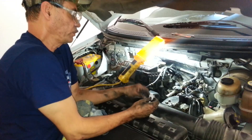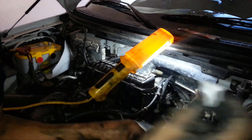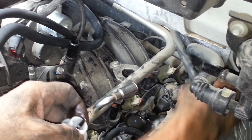You want to make sure you put on your safety goggles. You're going to be using this special tool — the size you need is 5/8 — and you first remove this lock from here. Then you put this in here and all you do is push back on it. You can feel right there where it released it, and just pull it back. This one didn't have any fuel pressure, which is pretty good, but usually you want to wear your goggles because this releases a lot of pressure all over the place.